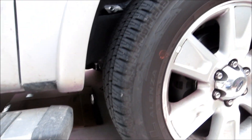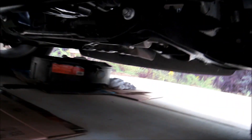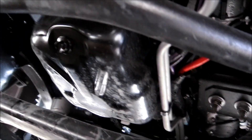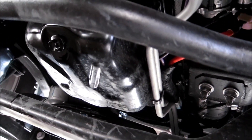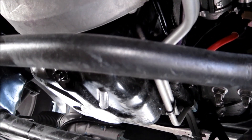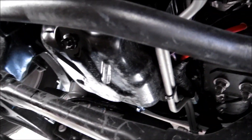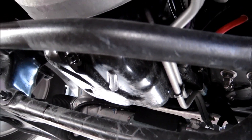Let's start off putting things in perspective — we're going to change the oil on a 2013 F-150. You're going to have to scoot your way under there, but there is your oil pan right there, and the bolt is a long bolt, one of the longest I've ever seen. Have your cardboard and drip pan ready to catch the oil. Be patient — you can crawl underneath your truck; you don't need to jack it up.